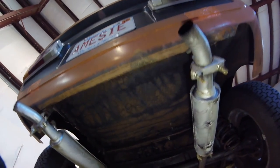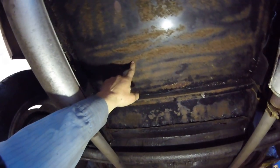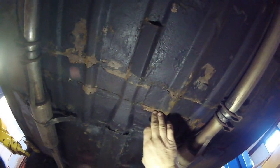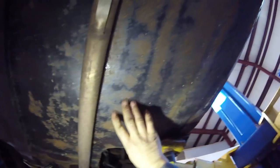I got the Sonnet up here on the lift and we can see all the metal I added when I raised the trunk up and replaced all that rusty metal. You can see it starting to surface rust. When I put this car together, I didn't expect it to last more than a summer or two, and here it is three years later going strong. So I'm going to nip this in the bud and get a little bit of that phosphoric acid on the trunk here. You can see some of these original areas with the original undercoating — you want to get as much of this off as you can before adding any rust treatment. For this case, I'm more interested in all the fresh metal I added. You can see we've got a little bit of surface rust and the black spray I put on it is starting to come off, but for how long I've been running this car, it's not bad at all. Let's get a little acid sprayed around here.